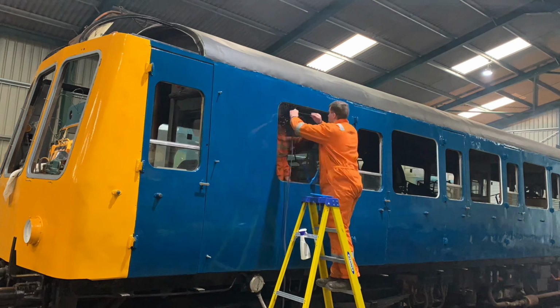So, as you would have seen in that little time lapse, I was welding the gutter together. This is now the gutter. As you can see, it's all in one piece. It's not perfectly straight, but that's all right because it's really flexible. I can twist it and the end barely moves. It's all watertight, and the key bit for us is that it removes the ability for water to drip onto the body side, which we don't want because that will show up after some time on the paint, and we want to keep the paint as good as we can for as long as we can.